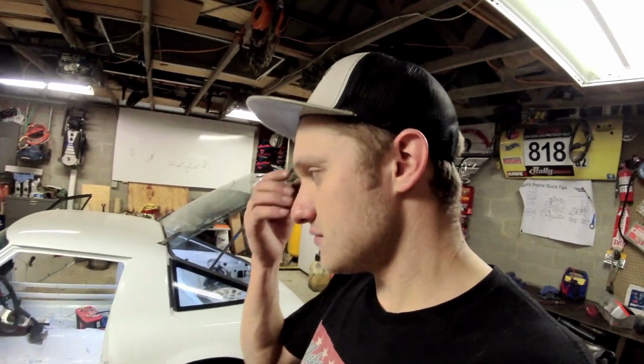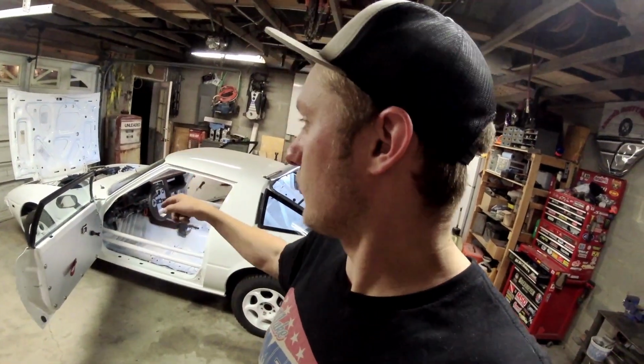Let me tell you, little aside before we jump to tomorrow whenever I'm finishing closing this video up, because it's late right now. I drifted a whole day in 100 degree heat with my silver Bridgeport, full Bridgeport 1980 RX7. 100 degree heat, never saw over 210 for my water temps, never saw over 220 for my oil temps, and the thing has a stock clutch fan and it would cool down in grid. So I could do 5 laps and I, as a driver, would get too hot and have to quit. And then the car was like, I'll keep going. Just let me sit here, wrap away, cool right off. So, clutch fan for the win. If you can run one, run one.